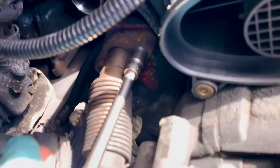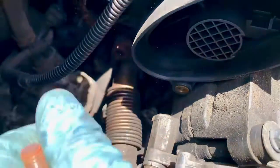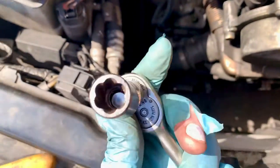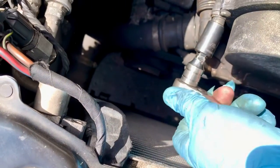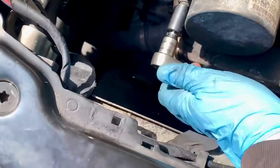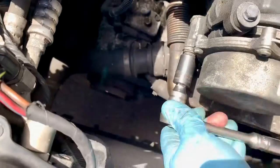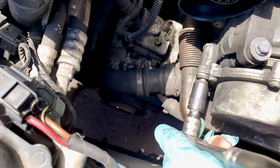These extractors do look better if you knock them on but I'm hoping I can get away without. With some perseverance I've managed to undo it to a satisfying extent. Underneath this non-functioning thermostat there's another 6mm which comes out with a 6mm Allen key this time, then there's another one under there. All that we've got left holding it is this which you can use a screwdriver for, but I decide to use a 7mm socket.